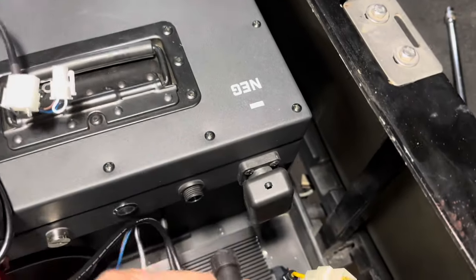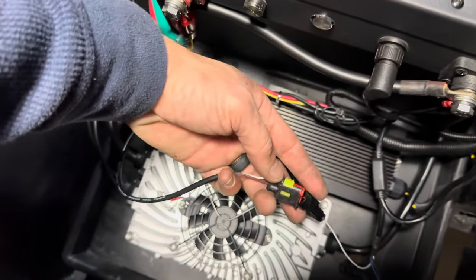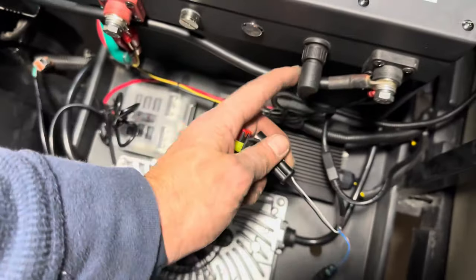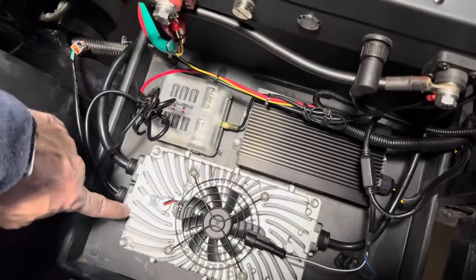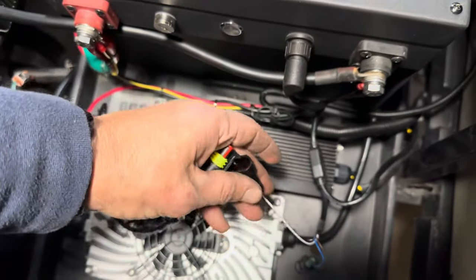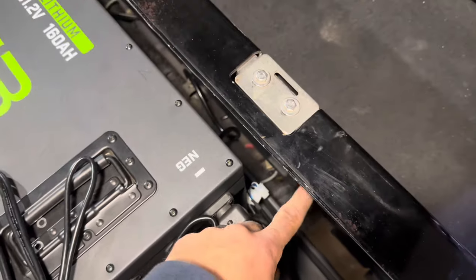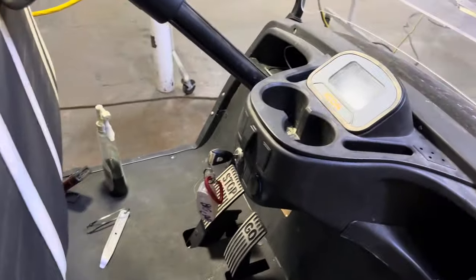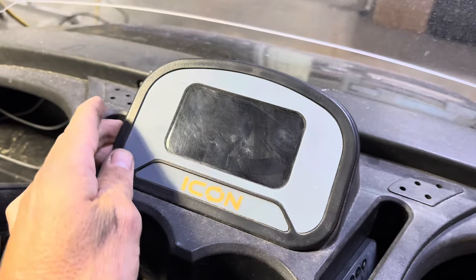Plug the LCD wiring harness into the battery and tighten it down. The last thing we need to do is connect the charger CAN communication harness into the LCD wiring harness. Where this plugs into the battery, there are two dangling ports — plug the signal output from the charger into either of those ports, as they're both on the same communication line. Next, run the LCD wiring harness down, secure it to existing wiring harnesses, and run it up to the dash. We're going to install Eco Battery's cluster replacement, which will add Eco Battery state of charge information to the display.